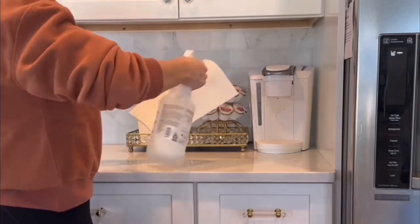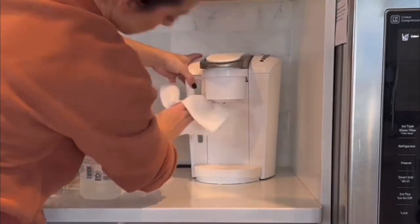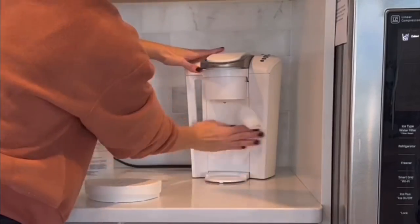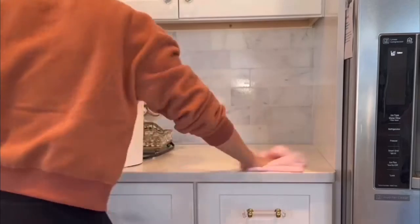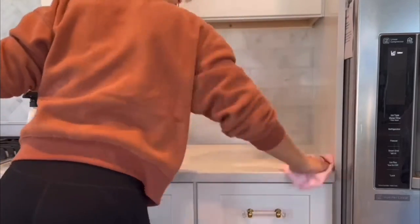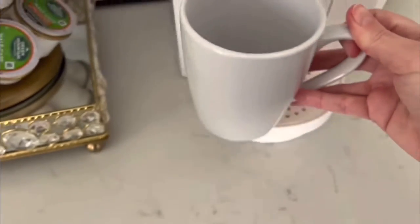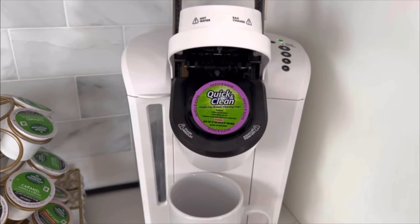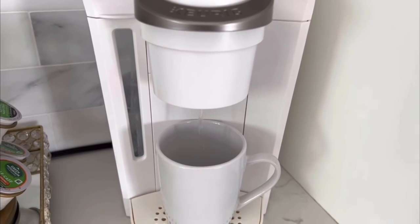The most used item in my kitchen is our Keurig coffee maker. Using just soap and water to clean the outside, and then I'm going to give it a deep clean and descale it. There are a couple ways to do this — you can use vinegar to descale, which is easy and the way I prefer, or you can use a product called Quick Clean, which is a little pod that cleans the brew of the coffee maker. It's not going to descale the water tank though, which is something you still need to do.